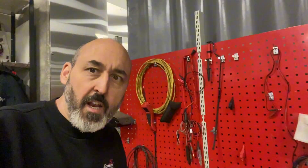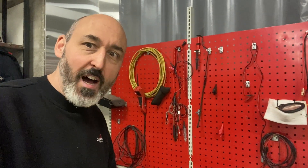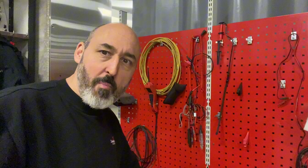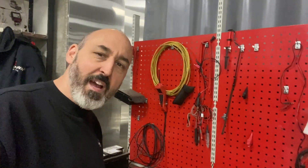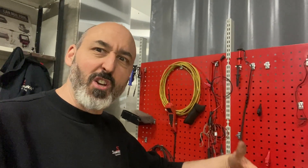Something worth knowing: this pump can detect a 24-volt external jump pack being connected. If you put a 24-volt jump pack on, the pump can diagnose that. It can also diagnose air in the cooling system and the viscosity of the coolant — amazing capability. Also, the shaft is lubricated by coolant, which is why there's coolant inside on that little silver cap. It's important when you set these aside during a major engine repair that you fill it with coolant, because if you run it dry you'll damage it completely.